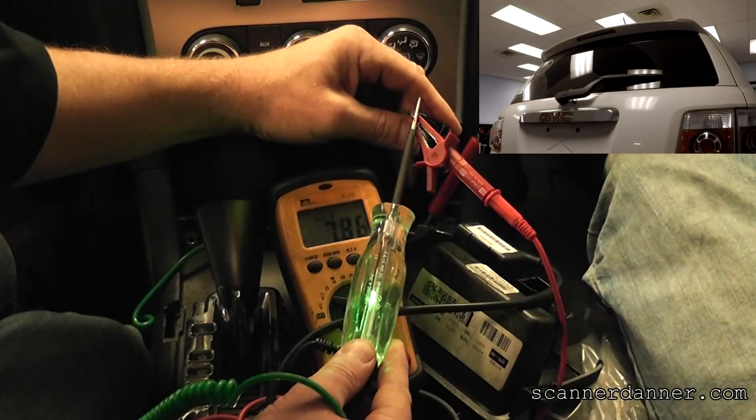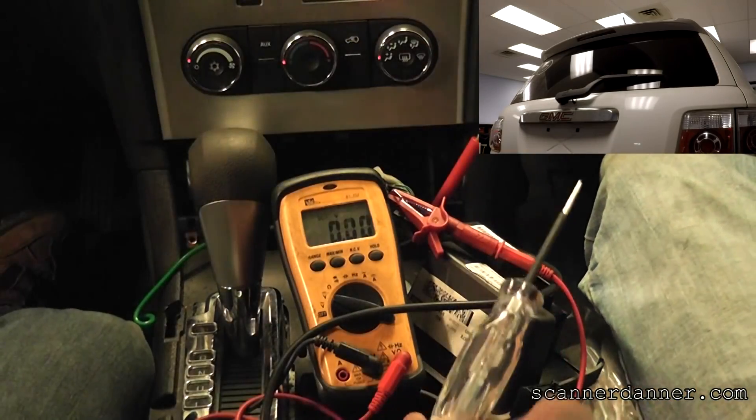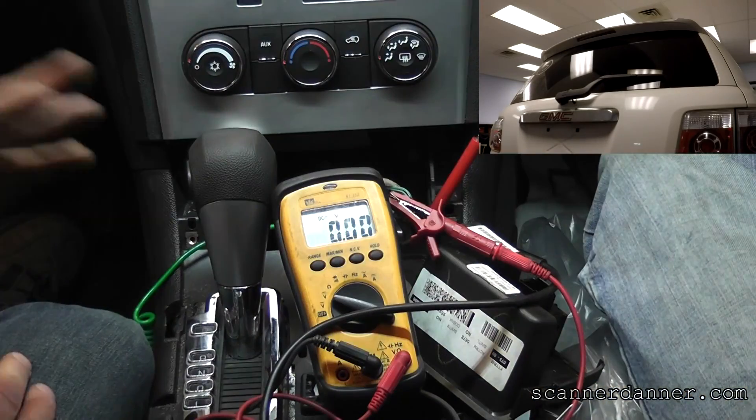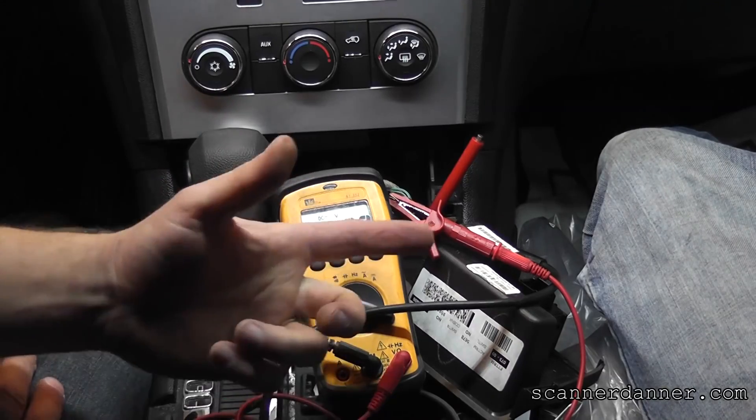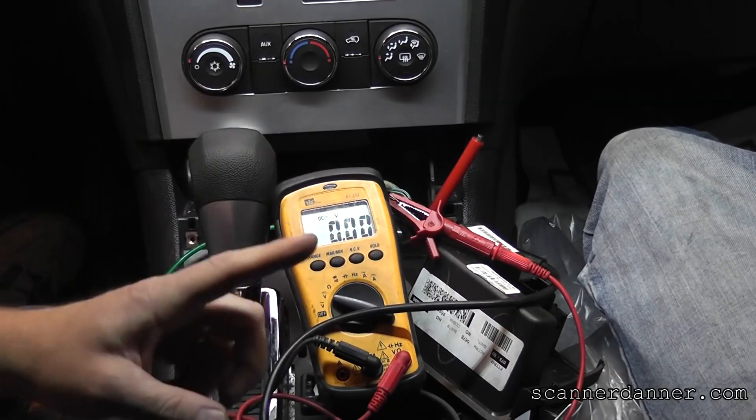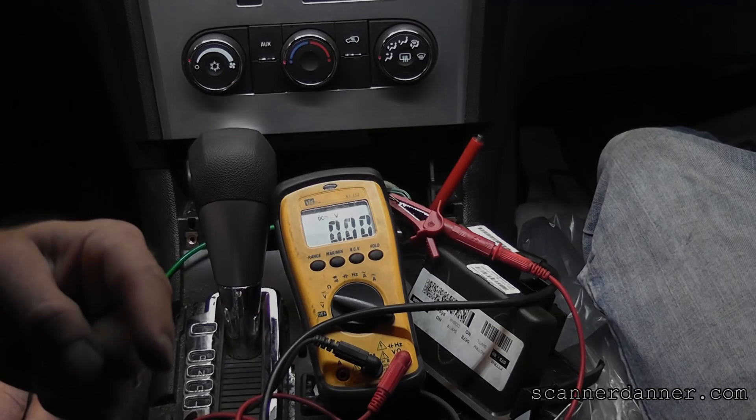You see the light's lighting too, a little bit. Alright, so the LED did work in this case. Pull-up design circuit — doing a bypass test using a test light is really what I showed you. I'm going to show you one more, and that's the washer circuit.